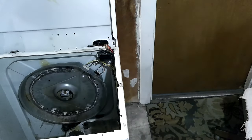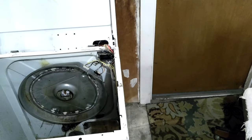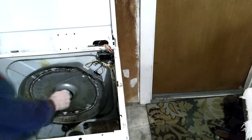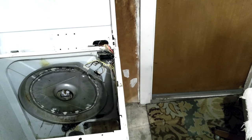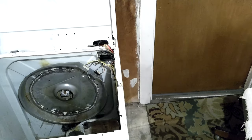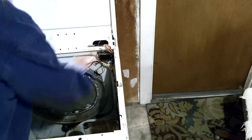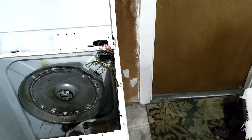You can probably see the general area a lot better now. I can't see a thing with that light blinding me, but I can't see to do the work without it. I feel pretty good about it working — it started heating up and I shut it off because I didn't want to damage anything. It wasn't coming on at all because the heating element connection was missing from about there to there. Oh, that's a ground.